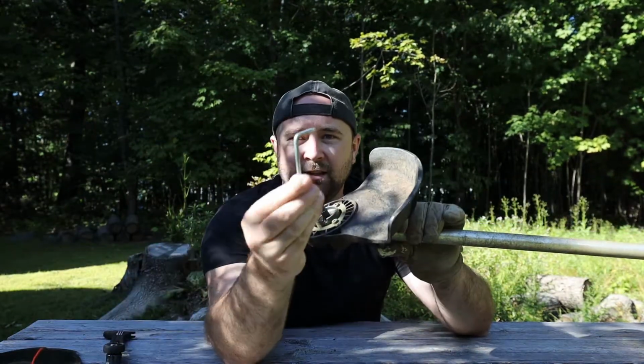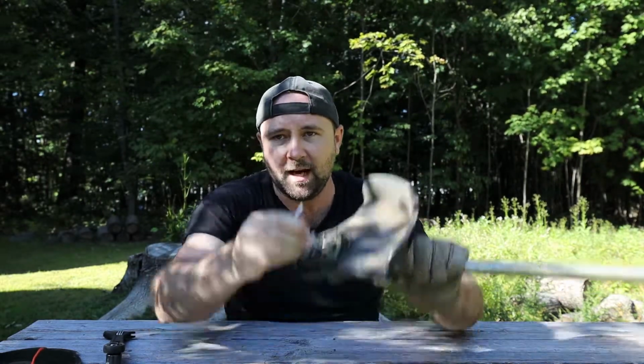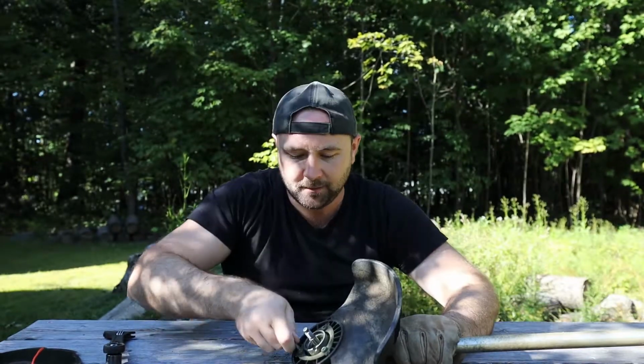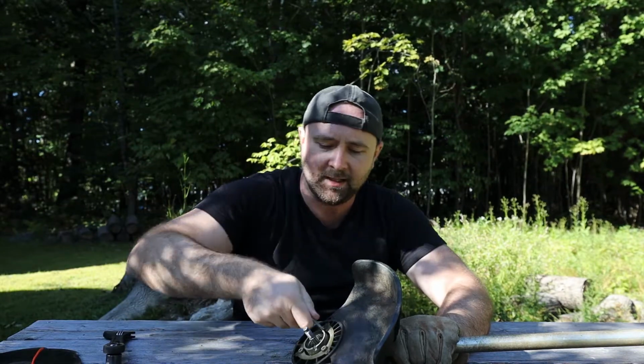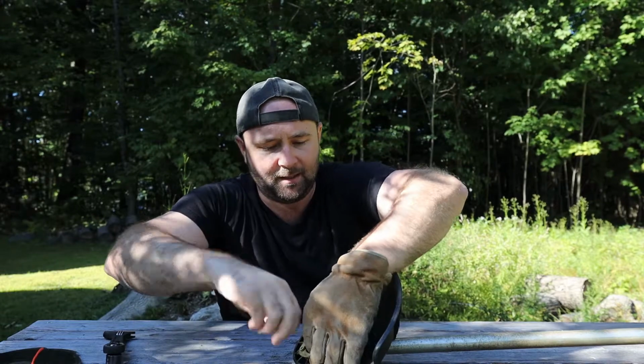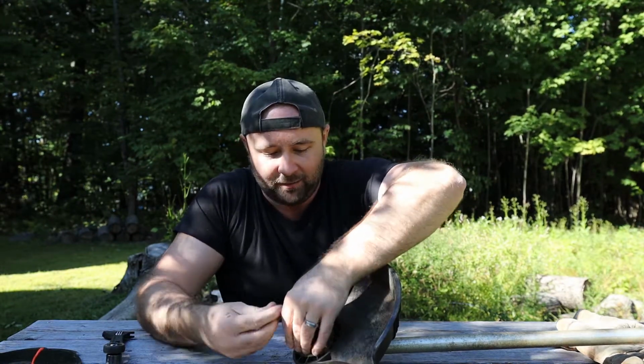We're gonna take the Allen wrench that comes with the trimmer, and it's a star Allen wrench. We're gonna loosen up the 3 cap screws that are on this guard. Loosen those up. These work just like any other screw does, where counterclockwise loosens, clockwise tightens. I take my glove off because apparently I'm not skilled enough to use an Allen wrench with a big thick leather glove on. We're going to loosen these right up.